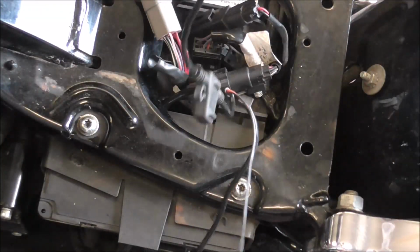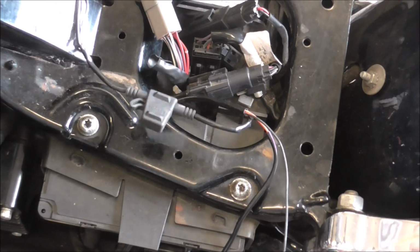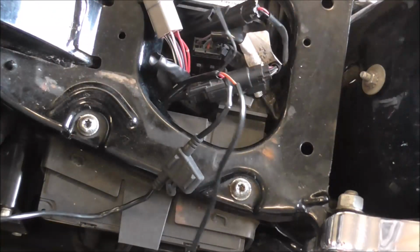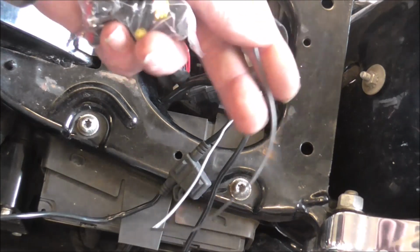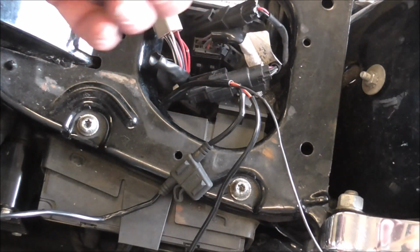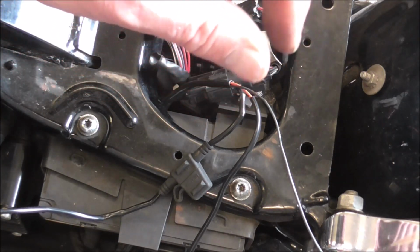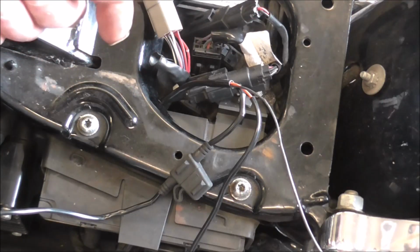There'll be another inline fuse. That main inline fuse is the one for the main power, but the switchable live has a 2 amp fuse on it, and I have got an inline fuse holder for that, so that'll be wired in as well. It'll all be heat shrunk, but on these connections I'll use the one that has adhesive inside that melts and seals it all, so it's all nice waterproof connectors.